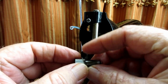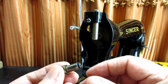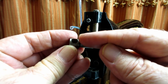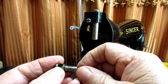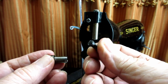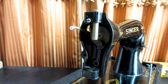Here is the connecting stud — the needle bar goes through it. Here's the set screw that you loosen through the back. When you're tightening that, it goes into the flat spot on the needle bar and clamps it in place at the height you set. So we can take that set screw out. It's kind of a long one because it has to get up in there — it's got a big head on it. We'll get this cleaned up nicely.